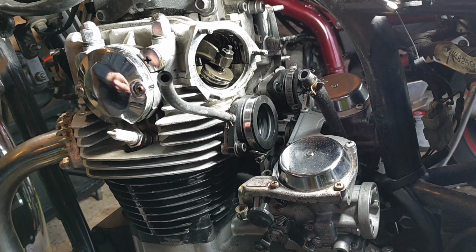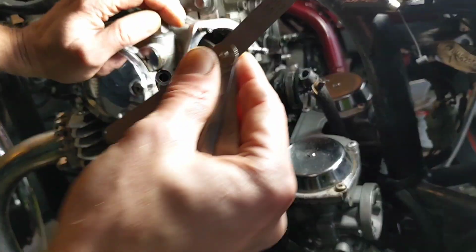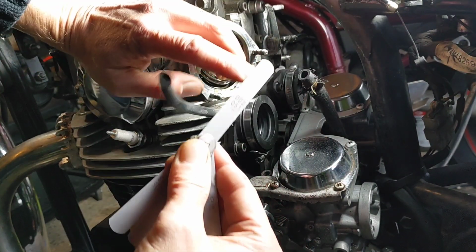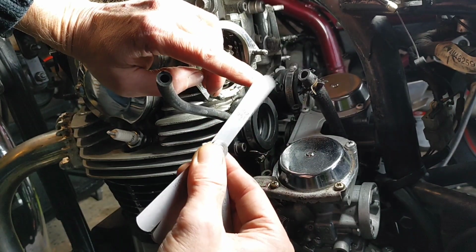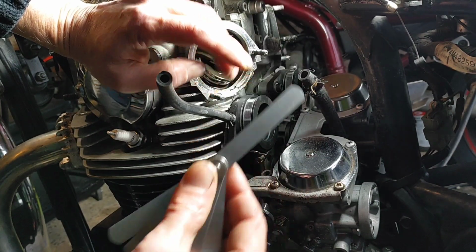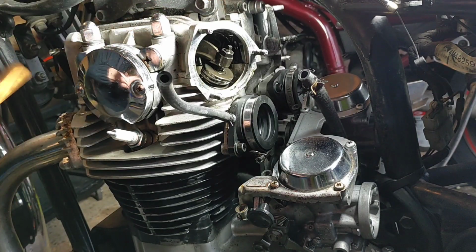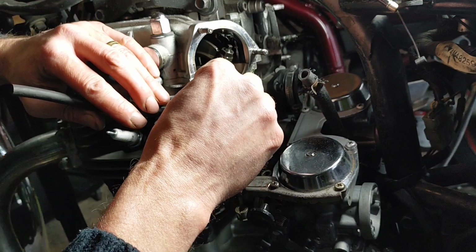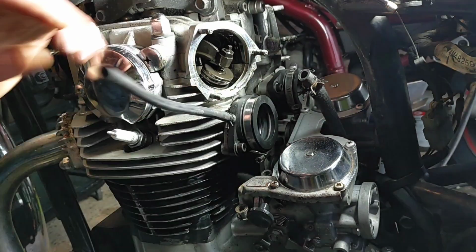Right, so a bit of a shifty round with the light source and everything else. I'm now on 0.05. Again, not sure if you're going to be able to see it. Oh, there you go, that's actually better. If it wasn't wagging. You can tell how thin it is because I'm struggling to keep it flat for you to see it. So there you go, 0.051. We'll just chuck that under the inlet. See how that... And again, that's really loose.